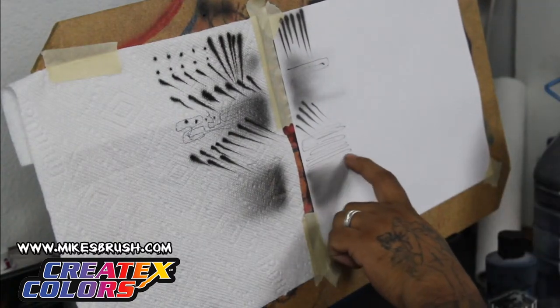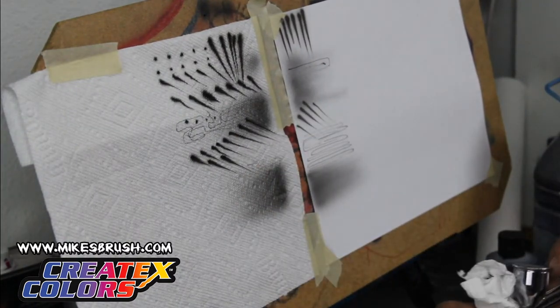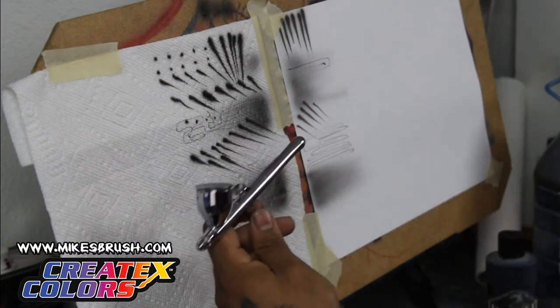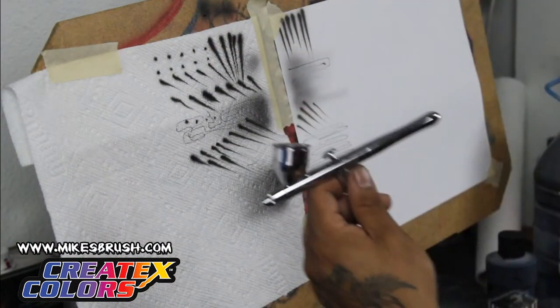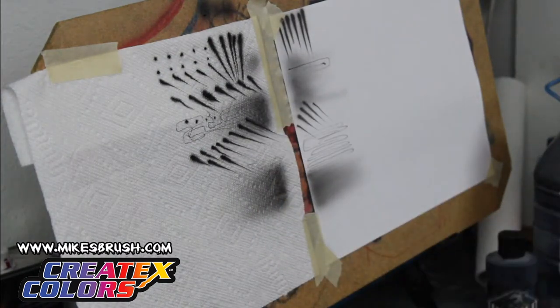Nope. I get splits or we get spread. So the air pressure's too high and the paint's not reduced enough to get anything finer than that. But before we move on, I'm going to show you again. This everything right here is good. Here I'm going to show you one bad thing. We're going to take the half and half mix and turn the pressure back up.